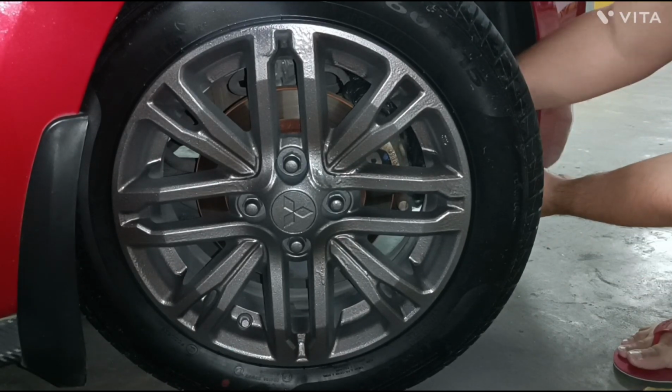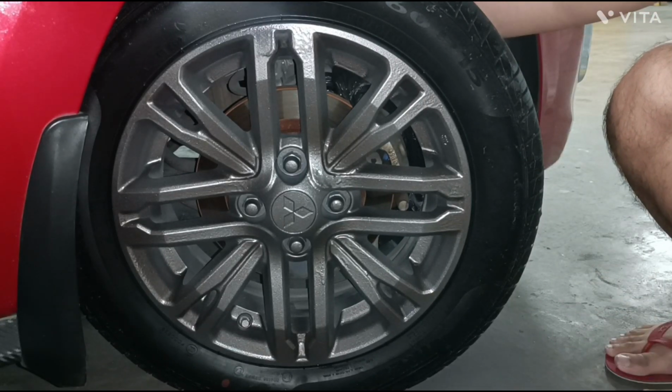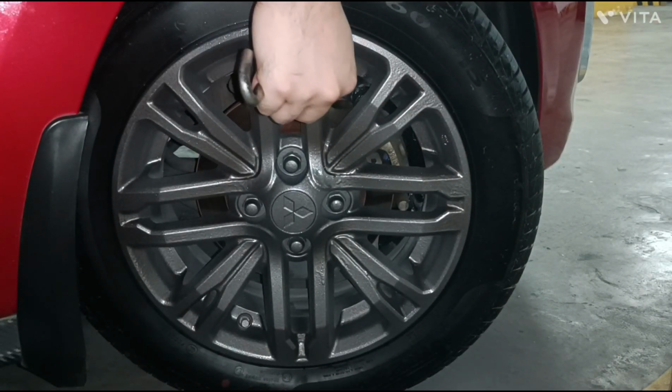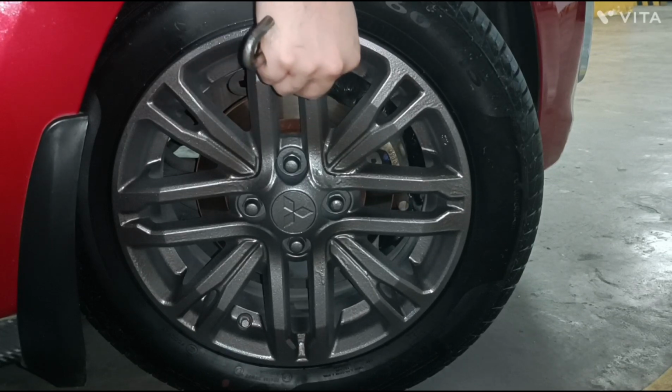You can clearly see the uneven thickness of the paint in some areas. That is why I prefer to remove the wheel and lay it down horizontally, so that if the paint runs thick, it drips inward the wheel, instead of dripping downward, or clumping in one location.